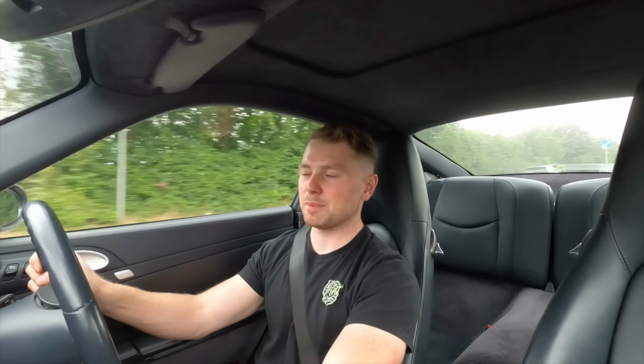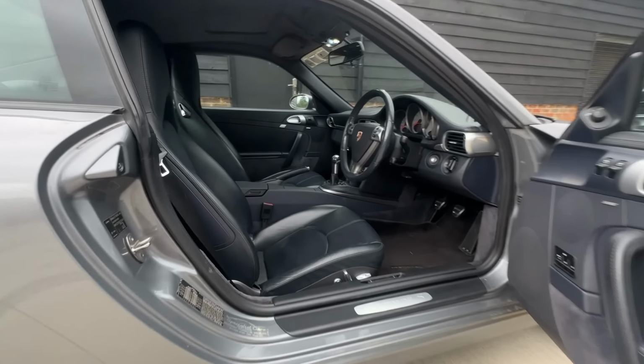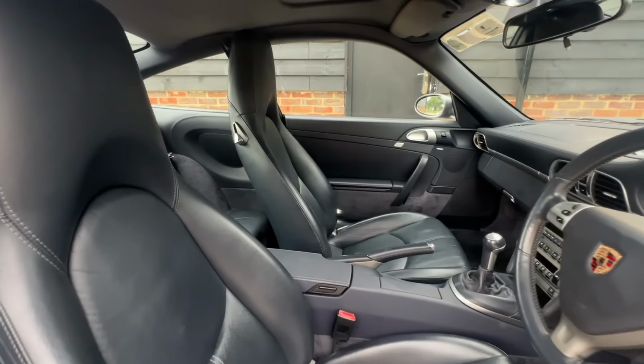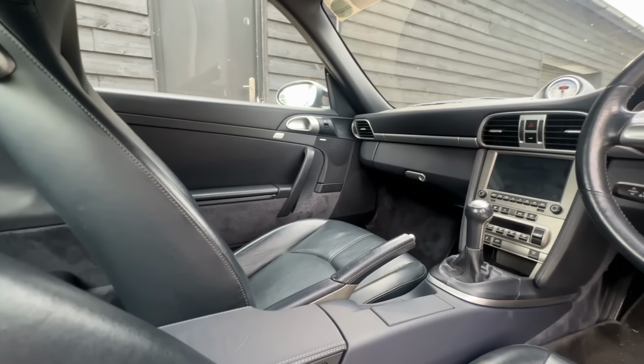So it almost sounds like we've spoken about before on the channel when you get a pinion bearing start to wear and you get that whine that goes up in frequency and pitch with the rev of the engine. You've almost got that coming through. Now in a track focused car, where you've got squeal from the brakes and you've potentially got chatter from the flywheel being a single mass flywheel and all that sort of stuff, fine. But in a car for road and not compromised, I don't know, but it doesn't seem to go.